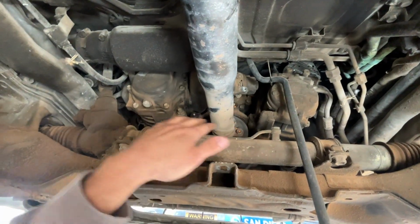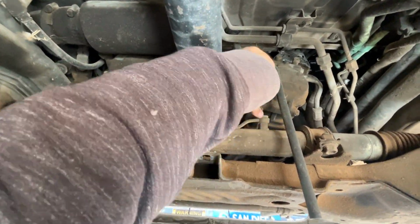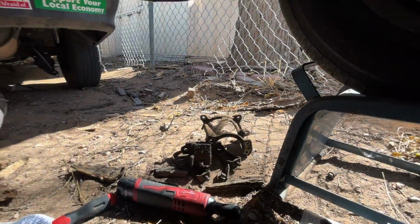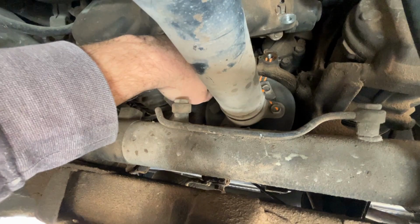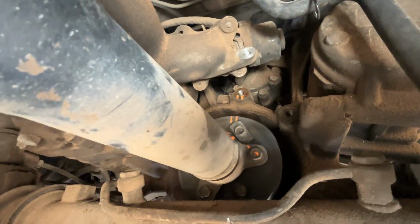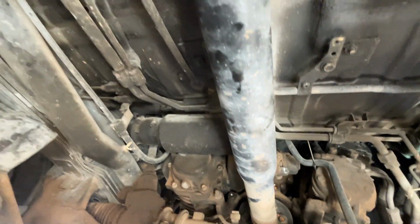I did end up having to take the whole horseshoe collar, and there's like a secondary clamshell bracket. It's all over there. See all that nasty gooey poo? I did have to take that off to actually get to the coupler, which I've aligned as well here. And I'm gonna have to take them three main connecting bolts. You can see this spins quite freely. It spins the fan clutch in front and all the accessories.